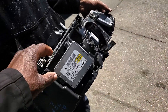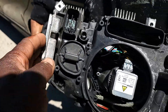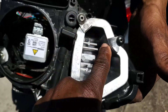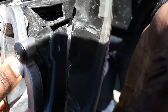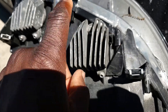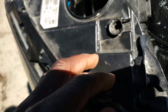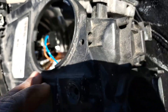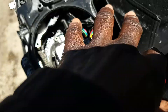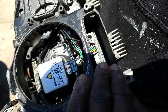When we opened it up, this headlight has a lot of functionality. We have one module here — it could be a ballast or a computer. We have the headlight ballast, we have LED signal lights, and a heat sink. This car also has adaptive headlights — when you drive at night and turn the steering wheel, the headlight turns with you. There is a computer here controlling that.